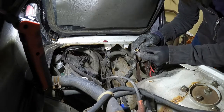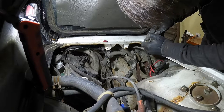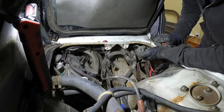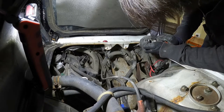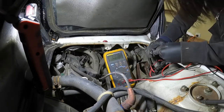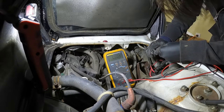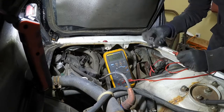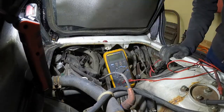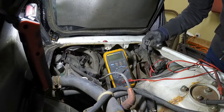I don't know if I can get a voltmeter in there — I might need to pull the lock out. I'm getting 0.8 volts. Well, that's not right. So I think that means we're tracking this wire back to see what's going on there. Unfortunately, I don't have a wiring diagram for this, so it means I need to wring out these wires manually to the fuse block.